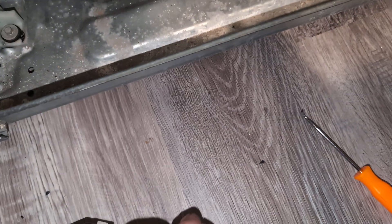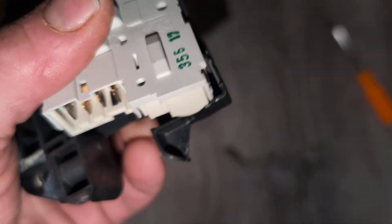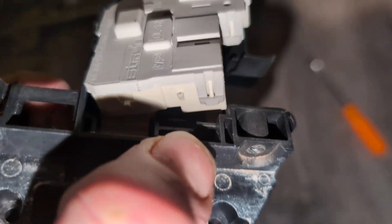You're going to unplug your lid lock, unscrew those two screws, take out this connector — it does not have locking tabs, it just pulls out from this connector. Then you're going to release three tabs: one tab, two tabs, three tabs — that little black lever down there.